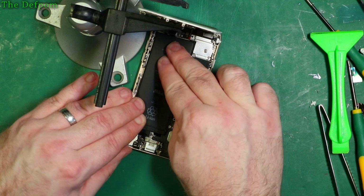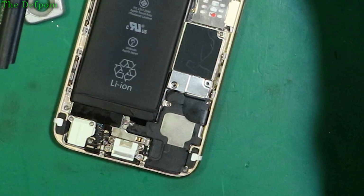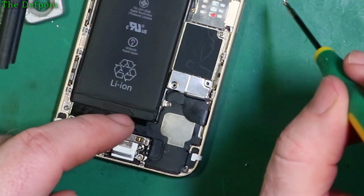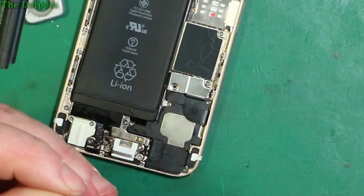Okay. Let's put the cover here back on again, and get the correct screws, short screws on the right hand side. Whenever I'm doing these, I always lay the screws out in the order they come out in. So a screw on the right hand side is on the right hand side, a screw on the left hand side is on the left hand side, and I do that pattern. So wherever it comes out from, I've got like a virtual pattern on the desk, and I put them back in exactly the same way. You have to be careful not to knock them. If you knock them, then you've got a bit of a problem. But that's when doing video helps, because you can always review the video. I suggest videoing stuff.